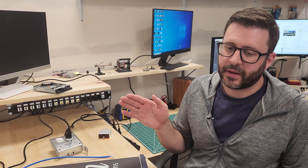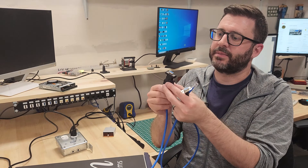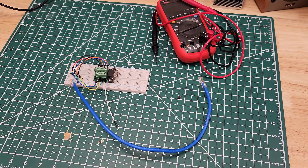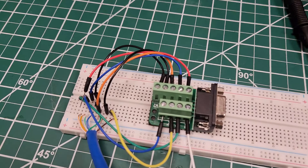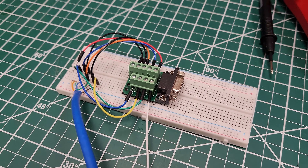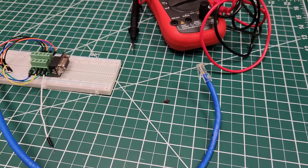It is, of course, a totally different pinout for serial than the cables I've already made for the MRV console, and also completely different than these adapters I got on Amazon. I haven't encountered anything that matches the pinout those are for. So we're going to make yet another bespoke serial-to-RJ45 adapter. I found the pinout online for the Sun, so this should be wired up correctly. Now let's try to talk to the LOM again.